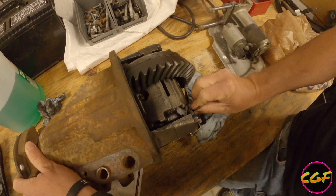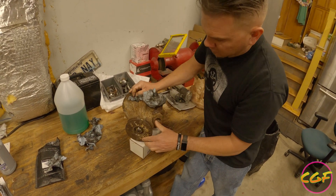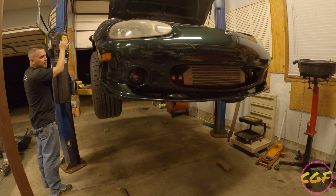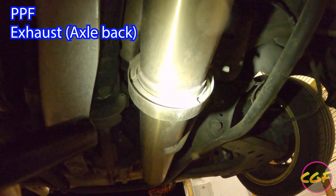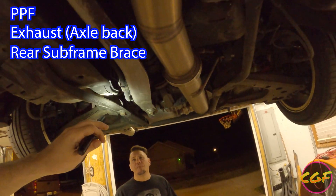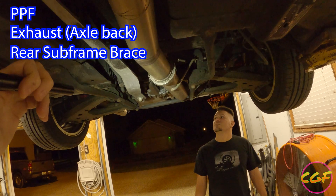It's much cleaner now — this thing was pretty grimy at first, but pretty typical. Looks like it's got about 86K on it. So how do you take a rear end out of a Miata? If you haven't been under a Miata before, this thing that spans from the transmission all the way to the rear end is called the power plant frame — that's going to have to come out. There's also a brace Mazda added around 1994 with the 1.8 cars that helps the rear end be more stable, but it also makes it really hard to take the diff out, so it's coming out too.